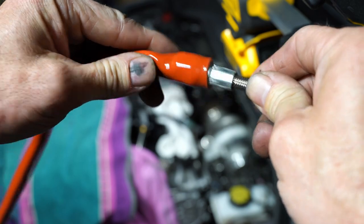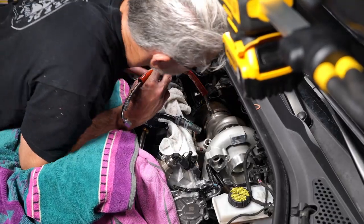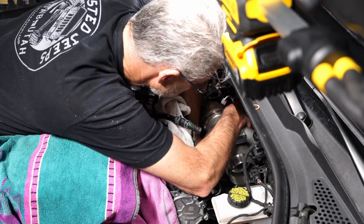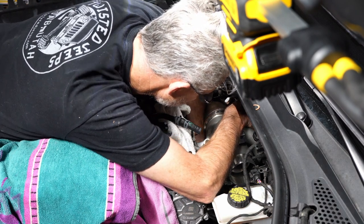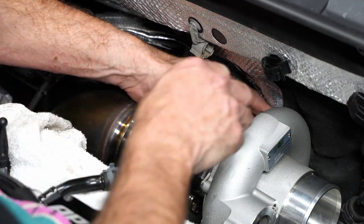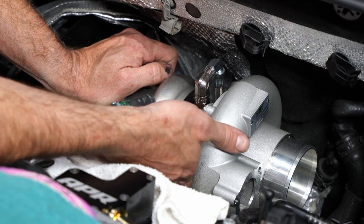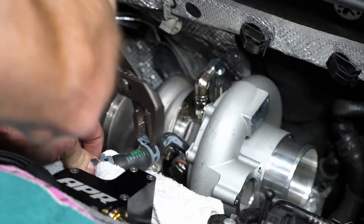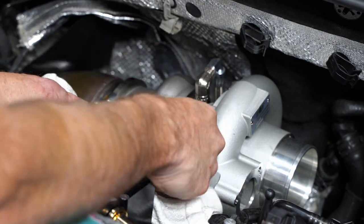For the oil feed line, I'm slipping over this heat protector right here. This is the only thing I didn't have pre-attached to the block - you could have put it on before you put the turbo in, and it's easy to get to with the turbo in, but I should have probably done that before. I'm loosely connecting it to the turbo using this 90 degree elbow, and I'm not tightening that down because I still need to prime the turbo. For the coolant feed line, same thing - banjo bolt with the pipe sandwiched between two copper washers, connecting to the coolant line on top of the block.